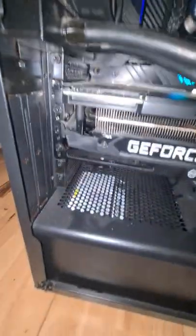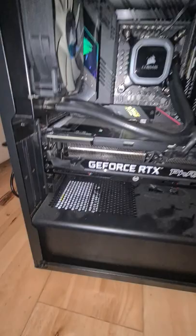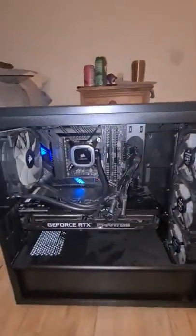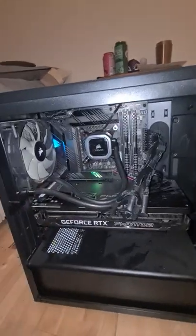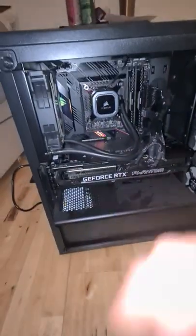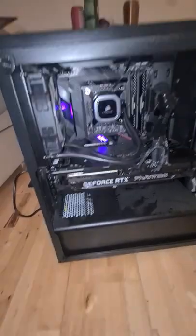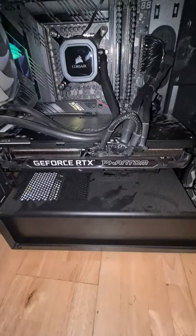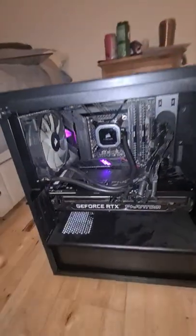I press the power button here and down here there's a slight metallic clicking noise. These lights will sometimes flick on and off, but as you can see, no fans have started up. It doesn't always do it straight away either — if I click it now I might not get it, whereas if I turn it off by the power and then turn it back on...